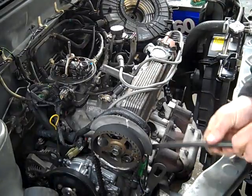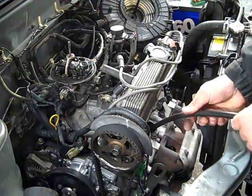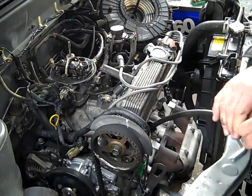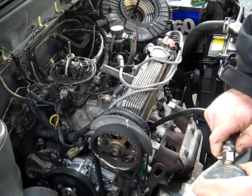Now don't ever put fuel oil in the cylinders — that is a no-no. That doesn't do anything for you. That's a trick that car lots came up with years ago. If I had this thing and I dumped some oil in the cylinders, it would show me a compression rating, but it has nothing to do with anything.